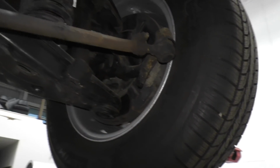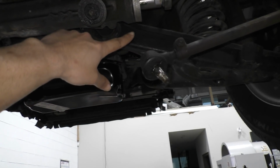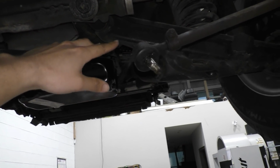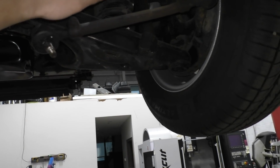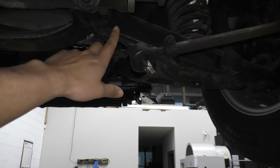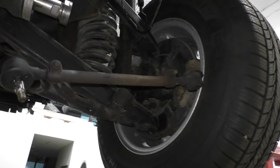We need to change these ones. And of course, we need to also change the location of this ball joint. We need to bring it somewhere over here. And basically, yeah, we need to make custom tie rod ends, we need to make custom tie rods, and we need to do a little bit of fabrication over here. Connect like a bar going across this whole steering rack so that we can add extra bolting points for the ball joints somewhere over here, so that all the geometry on the suspension is going to be perfect,